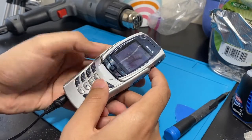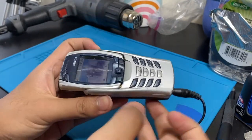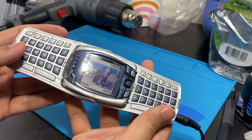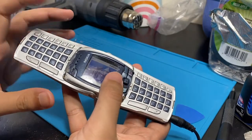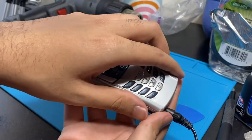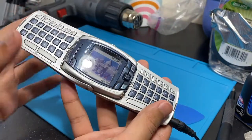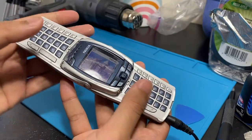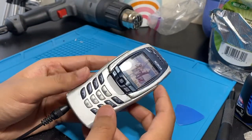Now, let's see if this mechanism will auto-rotate the display. So I'll hold it like this, and yes, it does work. So the magnet is still functional inside this section here. Let's do that again. Okay, so it goes back to normal. Let's do that once more. Perfect. So when the magnet lifts off from here, the phone knows that it has been taken away and the keyboard is in its open position, so it goes back to landscape mode. So that works just fine.